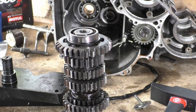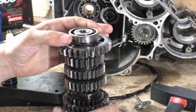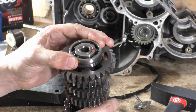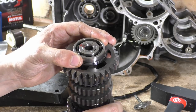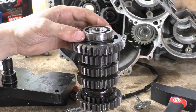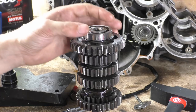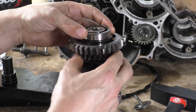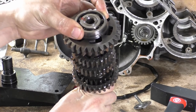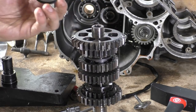If we put some dots on that you'll be able to see what's going on - there's our outer race, there's our inner race. If we hold our outer race still, you can see the shaft and the inner race are meant to rotate together, and the outer race is meant to be locked still. Then your balls in their cages are all rolling around - all good. The problem with this setup is that our outer race and inner race are now rubbing, and this entire shaft and gear is spinning when it's locked into gear, which means the gear is rubbing against our outer race, which will wear things out.